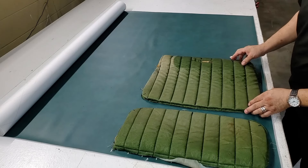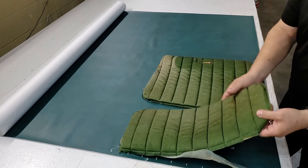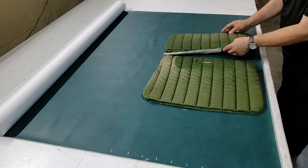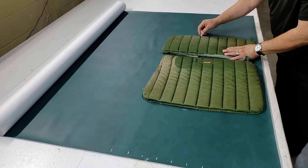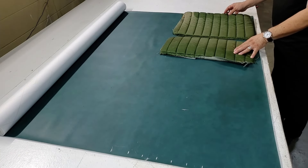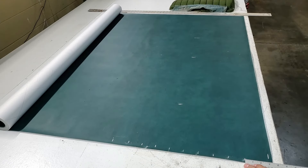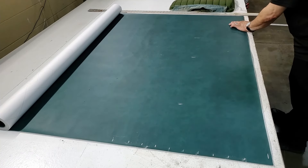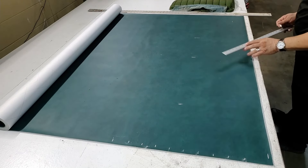I'm going to put this mark here, an inch past that, then take this one and repeat. Measuring from the edge on this first chalk mark, it looks like it's three and three-eighths inches from that edge. So I'll come up on the other side, measure the same three and three-eighths, and that's where we start — after that it's two-inch pleats. On the last one we're going to go two and a half.